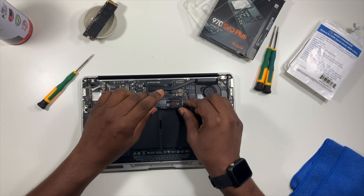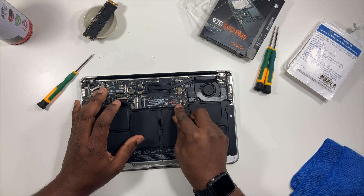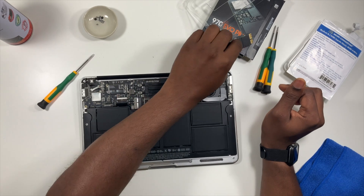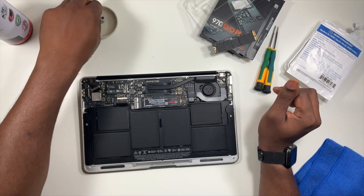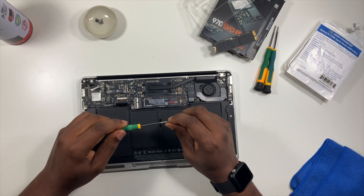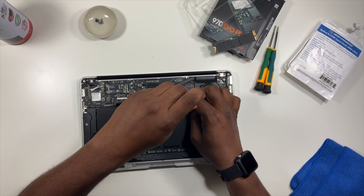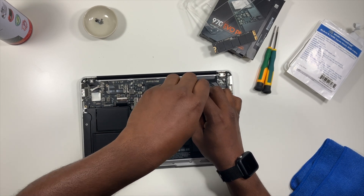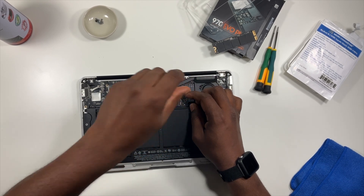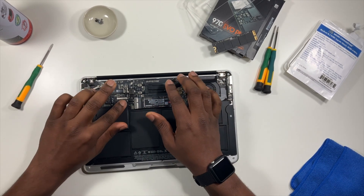Match it into the motherboard slot — it should make a snappy noise. There you go, hear that? That's how you know it's in there firm. Very easy little project to get these MacBook Airs back on the map. These MacBook Airs are almost 10 years old but still decent machines, especially the i7 with 8 gigs. For this model — 11-inch, 4 gigs of soldered RAM, i5 — it's not quite worthy of a terabyte for me, but if it's all you've got, put the terabyte in there. Reconnect your battery.